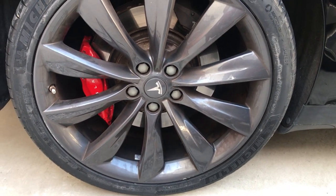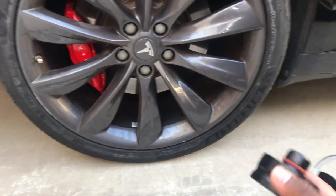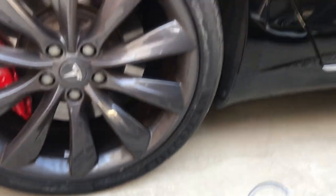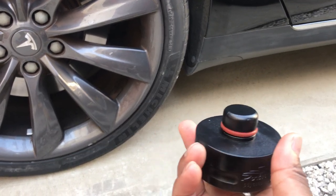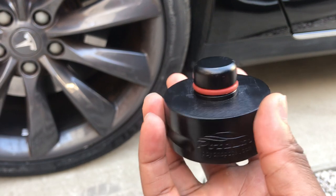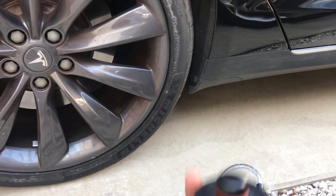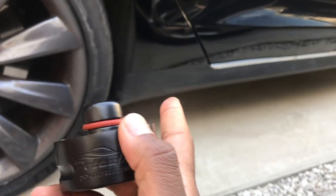When I got to my tire shop, they lifted the car. When you lift a Tesla, it's advisable to buy these — I call them hockey pucks, but they're jack adapters. There are four plates on the side skirts behind each wheel with three holes in them. You fit the adapter into one of the holes, twist it a little until it stays in place, and this part goes onto the jack while you're jacking it up. This protects the battery pack underneath the car from any damage.